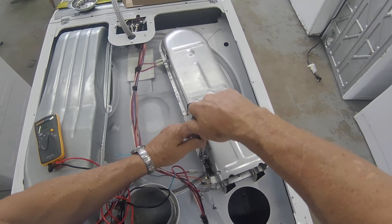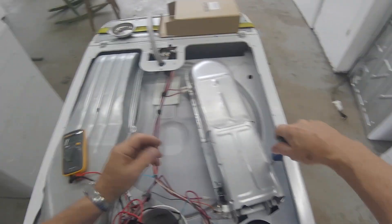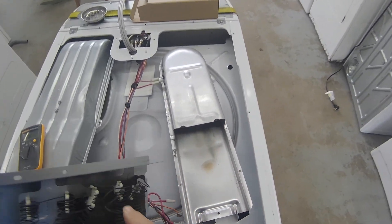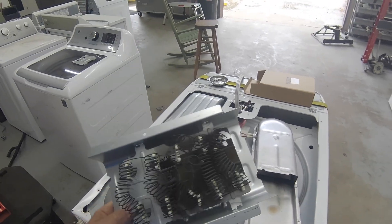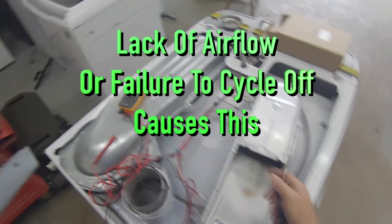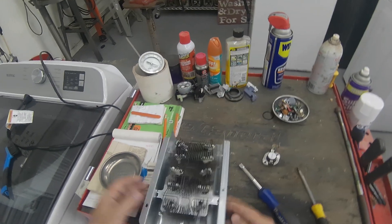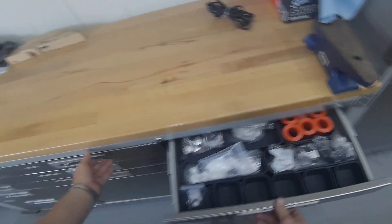Start taking this off. I think the rain has subsided enough that you can hear me now. We will remove this element. I don't know why we weren't getting grounded to the frame, because that's showing up differently. But yeah, this is dead. You can see there's a lack of airflow that did this, or it actually could be that it wasn't cutting off and was getting way too hot. We need this — actually we don't need this one because we're going to change it. Let's change those components too, because I'm going to resell this dryer and I don't want it to come back to me.